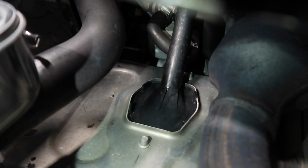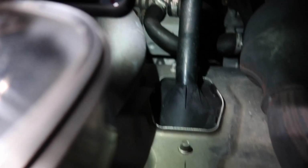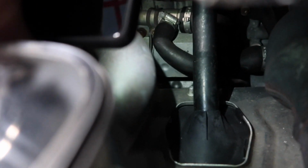So you see the steering column there, you want to look right underneath there, which is, this one has been replaced, but they have common hairline cracks and they'll leak right underneath there. Right in this area you'll see oil all over there, and that's from your oil cooler leaking. So that's what you want to watch.